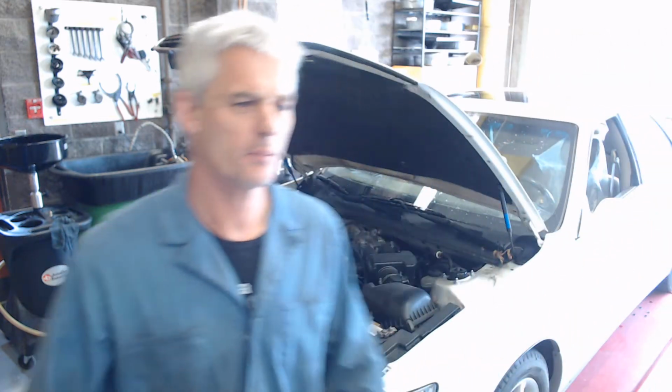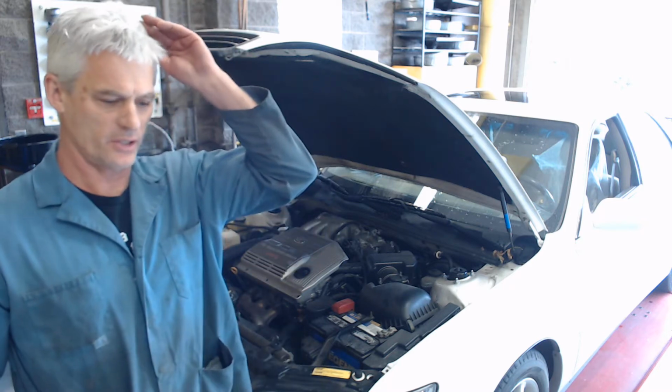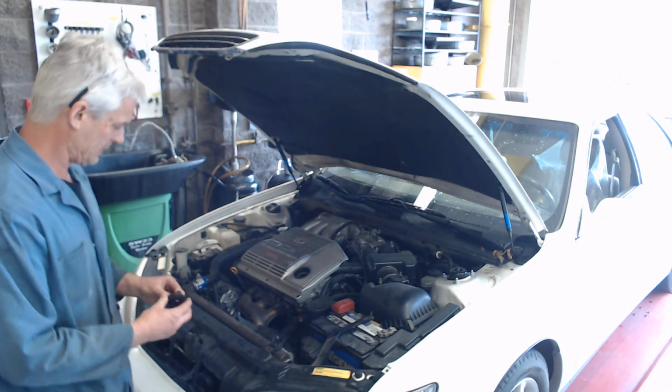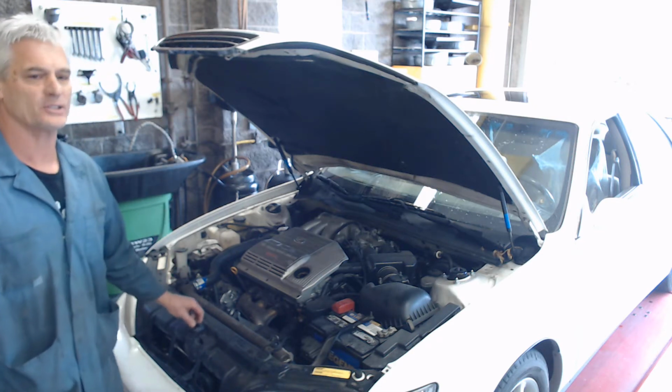All right, here we go in part 2 of our oil change demonstration. We're going to be showing you first here, or second here I should say, how to begin the oil change. So the first thing we want to do is take the cap from the oil fill cap off. Some technicians will put it there where the latch is. If they shut the hood, it won't want to latch, so they know where it is.